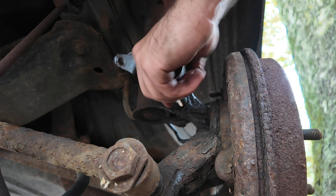Problems could be at the ordering house, at the parts department — you never know. I haven't found many but just to be safe I prefer to check. That's our new shock — hey buddy, oh he likes me. Let's compare old to new. I'm going to be looking mostly at mounting points: the three mounting points on the bottom — the one for the bolts, the sway bar link, and the brake hose. The height is the same, the positioning of the three bolts on top are the same — we're good. And good god, just look at this thing. This is what 25 years and 167,000 miles will do to a shock. You did well — we salute you, on to the next life.